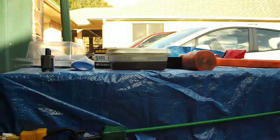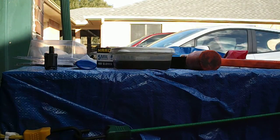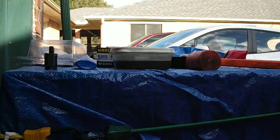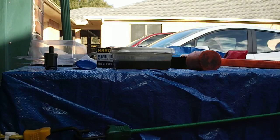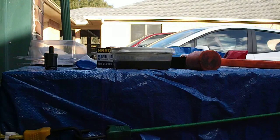Another thing that I do is I have a little Tupperware dish here that's full of 15W40 motor oil. I just give these pistons a real quick dunk in that just to lubricate everything, and then I actually stab them after that. If you have any questions — it's a pretty simple thing, it just takes a lot of time, especially your first time, to put these gapless rings in. The first time it probably took me a couple hours, and now I can do it in about an hour. Give me a call or look me up online at leroydiesel.com — my phone number is posted there. Have a good day.